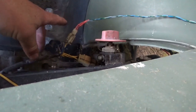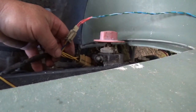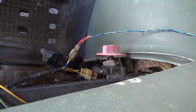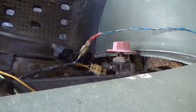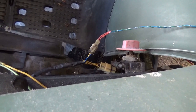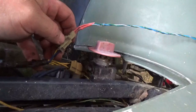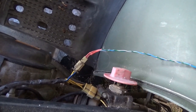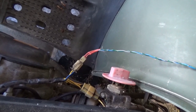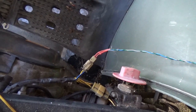Now the person asking for help says the wires are cut. So if it's cut right coming out of the engine, you have four yellow wires and any of them could be one side of your pulse generator. How do you determine which one it is? You go from the blue wire to each one of those yellows — it should be open three times, and you should get a resistance somewhere between 35 and 500 ohms. For the three stator wires, the resistance between each one should be about the same and relatively close to zero.